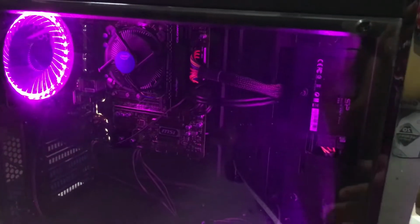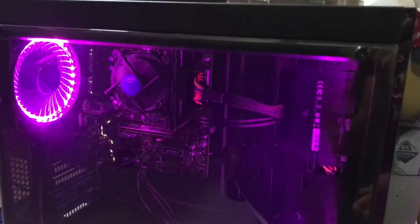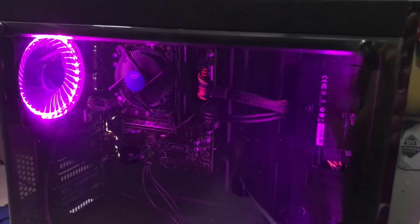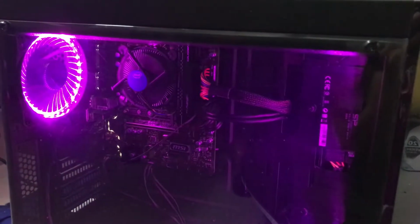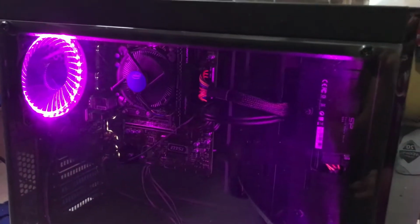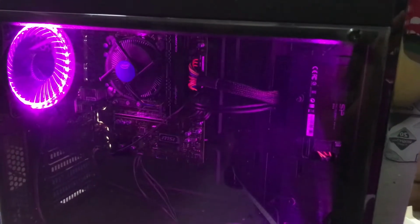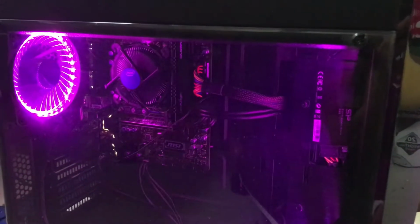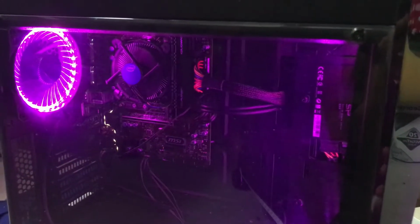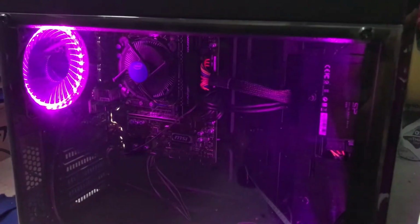They do have another version that's even a little bit cheaper, that's 3-pin only, and that would be what I recommend for your case. Of course, the 3-pin fans, as you probably saw in the specs sheet I showed you earlier, actually have a lower noise output. So they have been optimized for running at full speed all the time, while these have not. So yeah, I definitely recommend those if you're only going 3-pin. However, if you have these lying around, they will still work. Just note they will be quite loud.